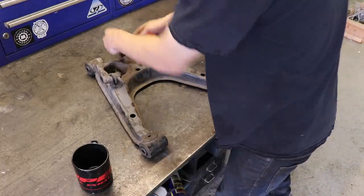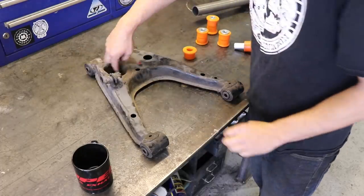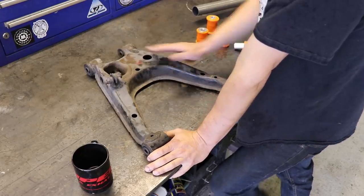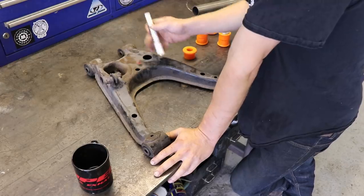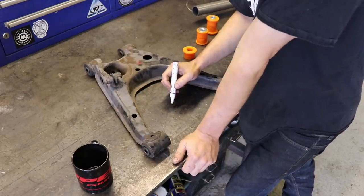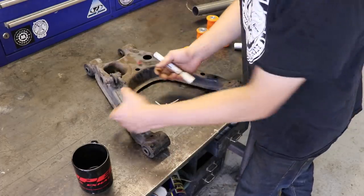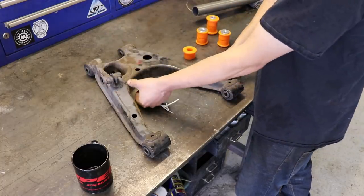So we'll make a jig for this, which will just have tabs on each of these, something locating where the shock bolt's in. And then what I'm going to do is make a flat cut out of this, which I'm going to cut out on the CNC plasma, which will be a similar shape, and then all the way around the side, it'll be kind of like I-beam construction, if you like, with weld all the way around. So this will be flat, but you'll have a running lip that runs all the way out there, round there, down, up and around,